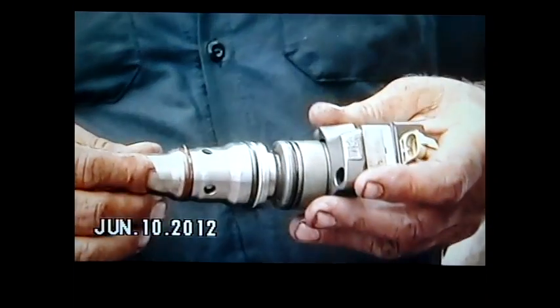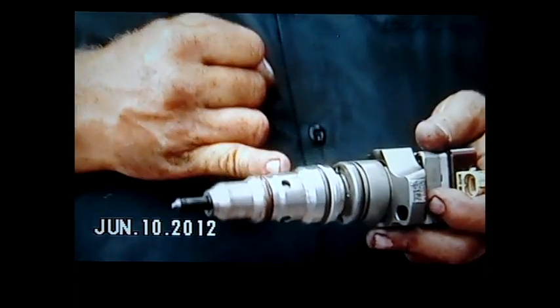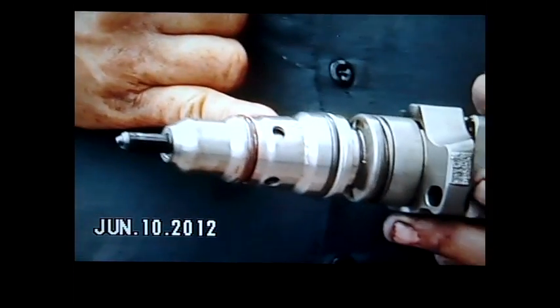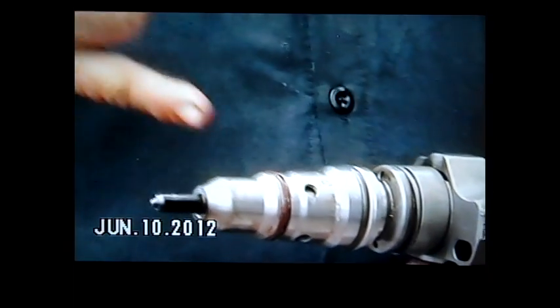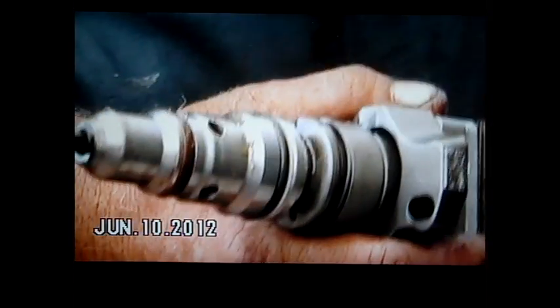We're looking for a drop in RPM and a miss. This one made no difference. So here we have three O-rings, two sections. The bottom portion is your fuel galley — it is constantly supplying 50 to 60 psi fuel pressure. There should be no fuel injected until we get our pulse width signal and it fires off. A stuck injector will just constantly dump fuel into the cylinder, causing major smoking and that engine knock.